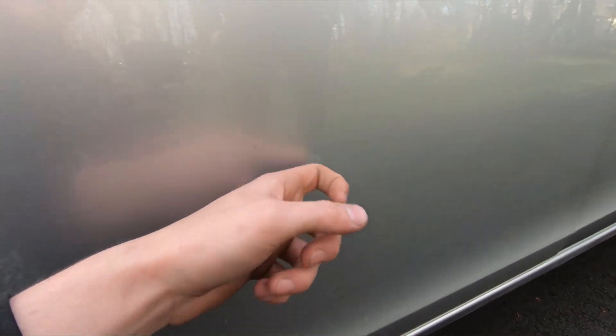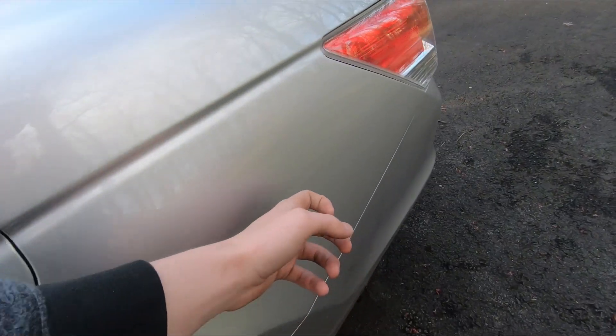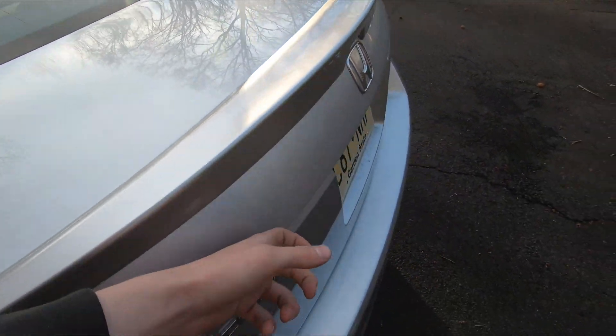Here's the fender — just straight metal — and here's the door. With the Kilmat on it, I feel like I'm just hitting a block of wood. We put some in here too, though we weren't able to get too much because of the bracing. The trunk also feels solid now. We're going to test how much sound is escaping from the inside to the outside — playing the same track again with the volume set to 40 on the Sony, and I'll be about five paces away from the car.